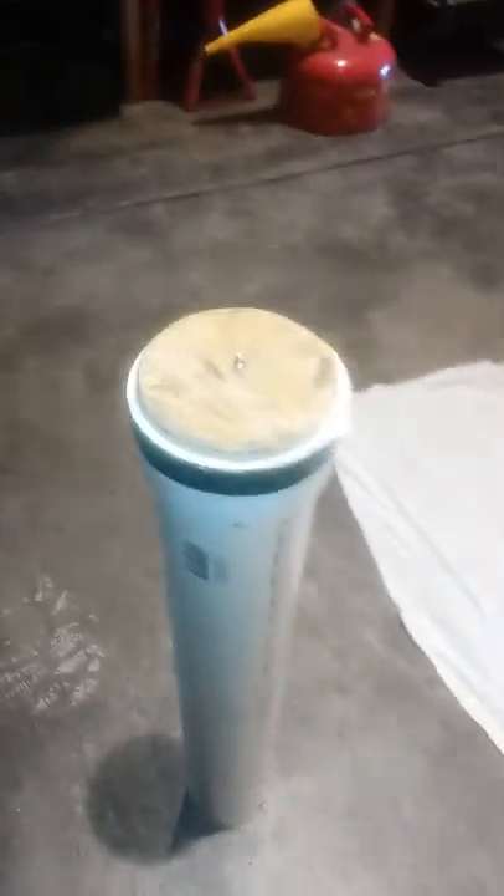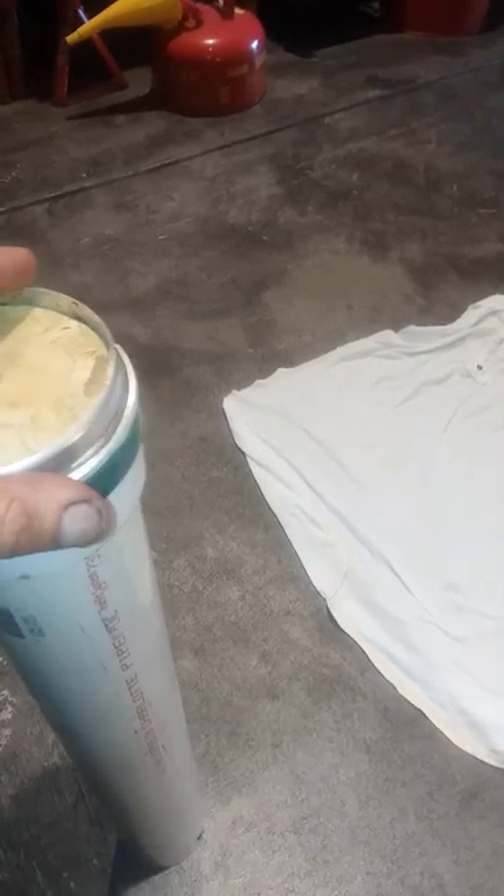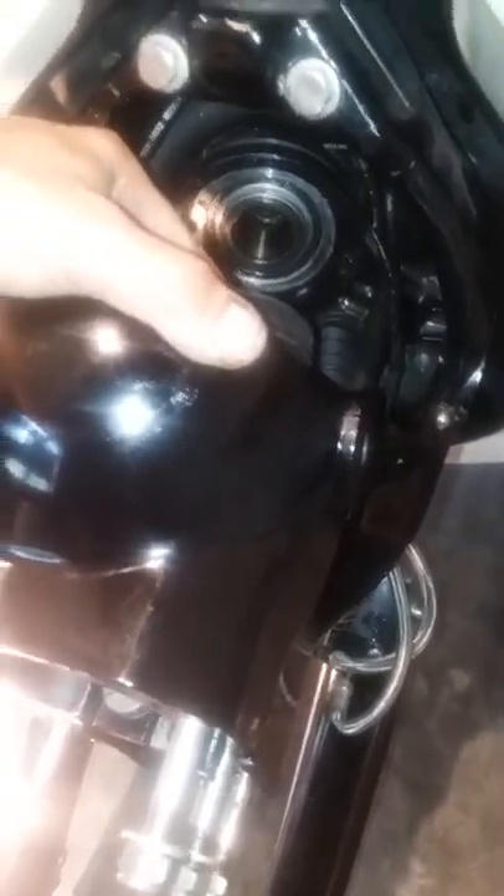So I'm trying to put it on the bell housing side first with the bell housing obviously loose. I have it connected by the water hose, the hydraulic fluid hose, and reverse cable all hooked up, but I can reach back here. I made a little tool out of three-inch PVC — this is a drain fitting — and cut a piece of wood to hold it centered. I'm going to put a bunch of adhesive around here and push that into there to hold it on center while another hand holds the bellows in tight. This is my second attempt.